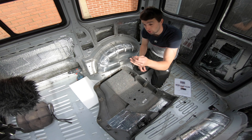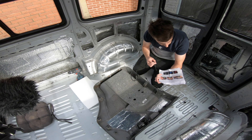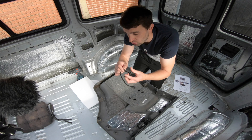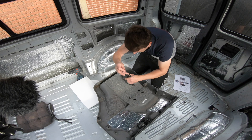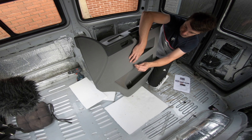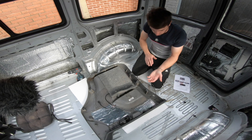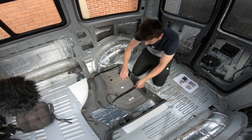That actually holds really tight — I was a bit skeptical. You push it through your new hole from the inside of the door card out, then locate it into the LED bezel holder. You put it into the bezel holder and clip that in as one. Because it pinches with the teeth, it holds the LED in place. I thought it would just pull back through but I was wrong. They're quite strong — quite impressed. They even give you sticky pads so you can hold the wiring in place.